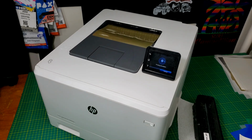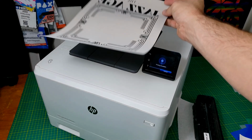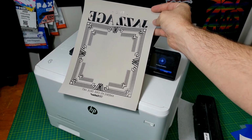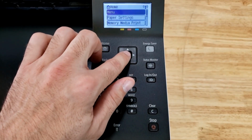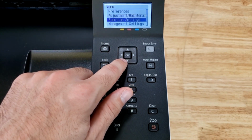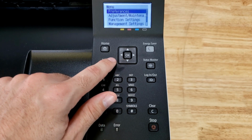Just take caution if you're going to be using the larger office copy machines like Xerox. They specialize in bulk copies and may not lay down enough toner for the paper to work properly, according to my sources at Forever. The main thing that matters when you're using these printers is that you select the correct media settings so that it slows the paper down and correctly fuses the toner to the A sheet.